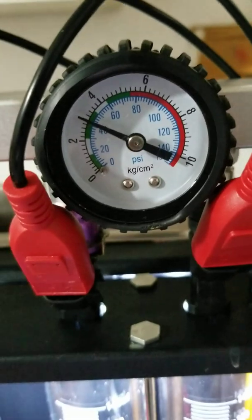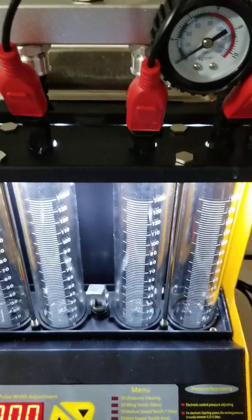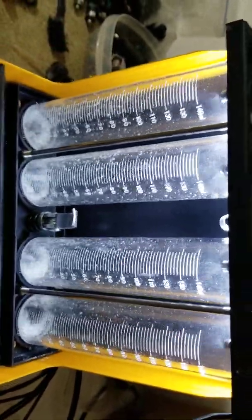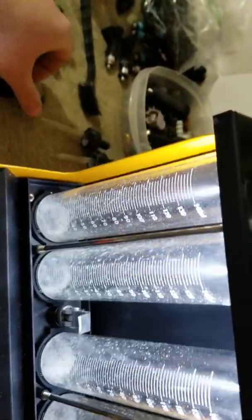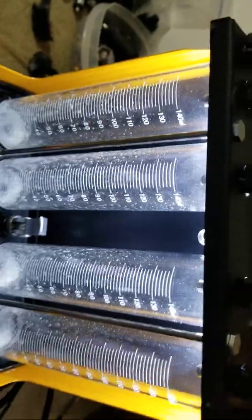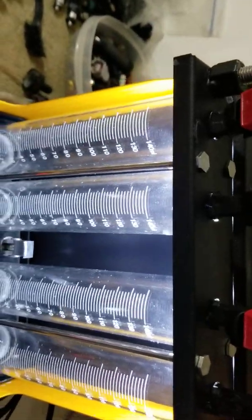We're at 40 psi, so we'll go to idle. I'll turn this sideways so you can see all four. Here they are idling — same spray patterns. So here's the ID1000: it's got a single orifice tip, ball seat, 360-degree spray pattern. And that's the same on the Bosch 95 — same tips, same spray pattern, great atomization, 360-degree conical spray.